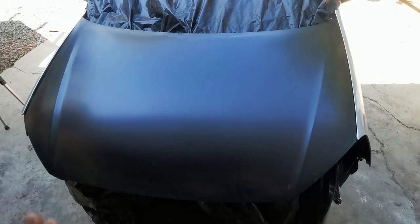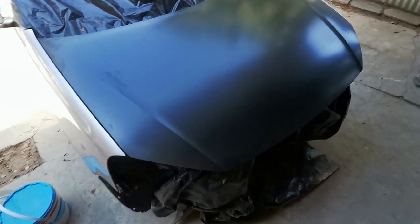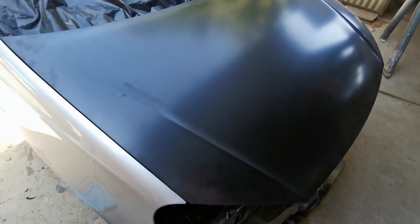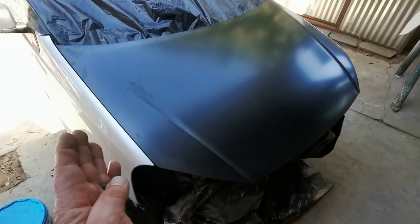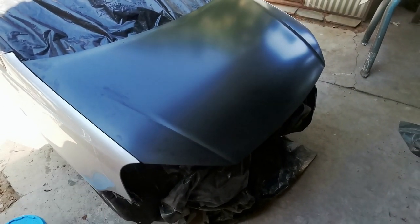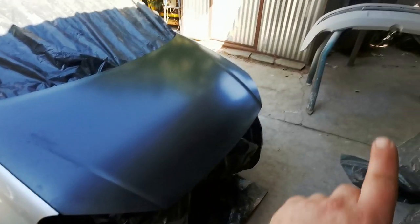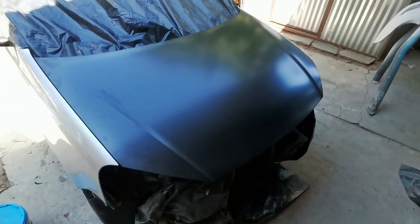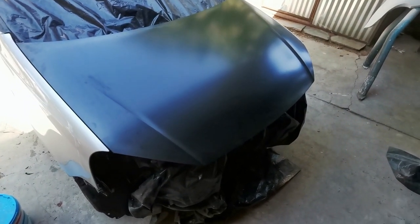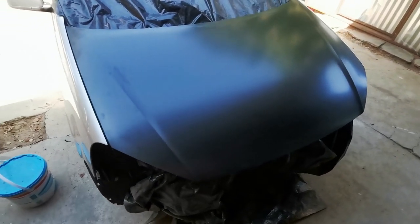And if all that is done, then I can give it a layer of silver paint, two layers of paint, and just mist over to this fender as well, so that it will blend properly. And if I'm satisfied with that, I can give everything a nice two coats of clear. And the same needs to happen with the bumper. And if all that's done and dry, then I can finally assemble the car and get it ready to give back to the client.